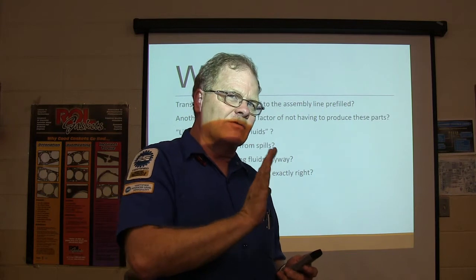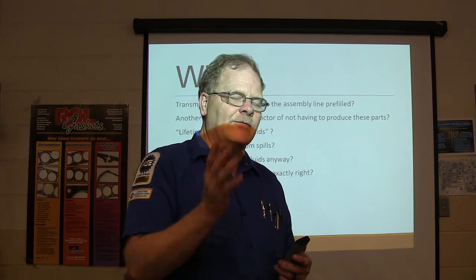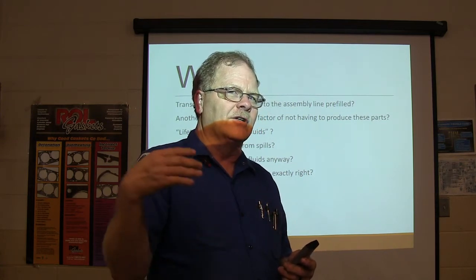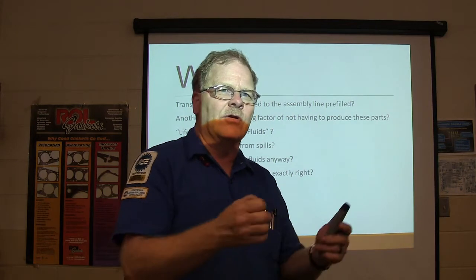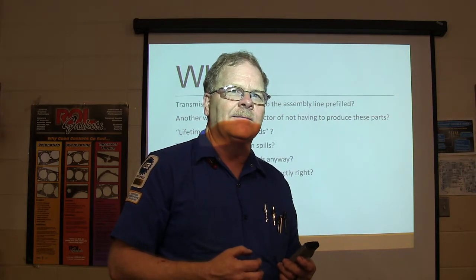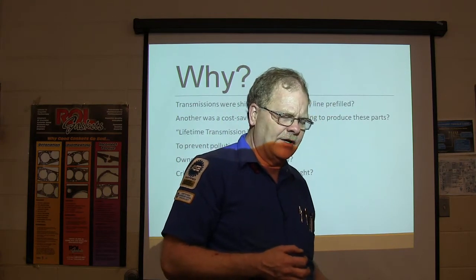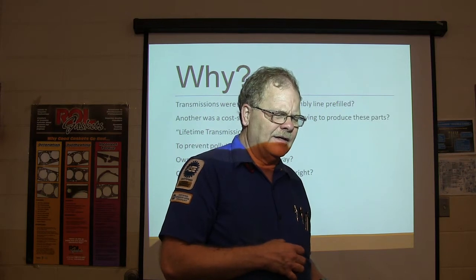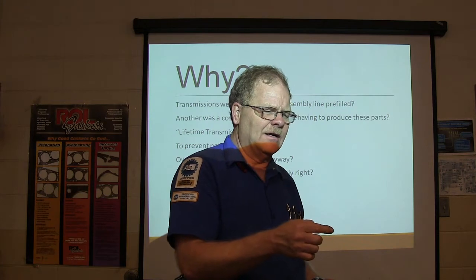If it's supposed to have a controlled slip and be slipping smoothly, it's got friction modifier in the fluid. If that friction modifier begins to break down, well, on some of these Crown Victorias, you'll feel like you're running over those little speed breakers right before you get to a stop sign. You know what I mean? It chatters like that, or you'll feel what feels like an EGR surge, and it'll be transmission fluid related. See what I mean? And one time I had this vehicle and the transmission was acting crazy. It was an old little LTD back when I was at the Ford place. Somehow the dipstick had been pulled over and it was under the suction line on the air conditioner.